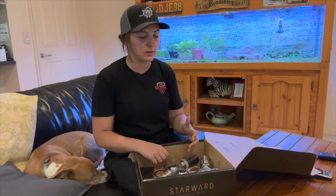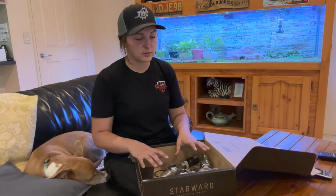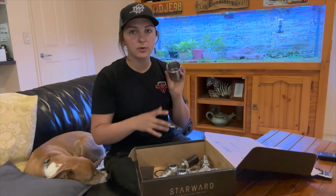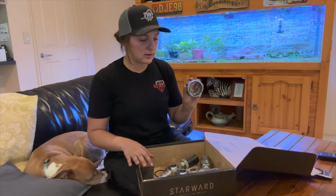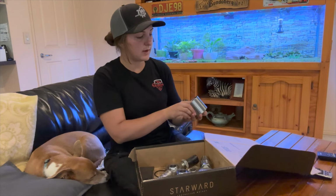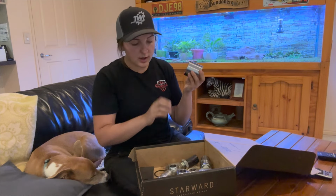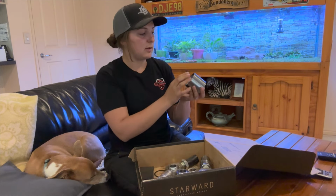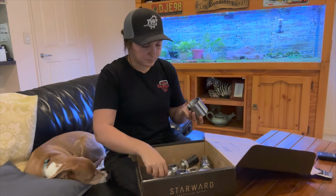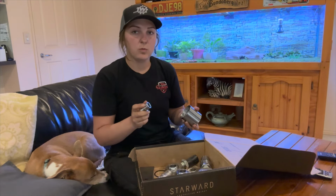Of heims, uniballs, misalignments, etc. So everything I've got here we've purchased from DFI, Design Fab Industries. And I'll start with the 1-inch uniball cup. So on the chassis end of our upper control arm, we will be using these uniball cups. We've got one here that's already got a uniball inside. So the uniball slides into the uniball cup like so. And then you've got your circlip that holds that uniball inside the cup, and a misalignment spacer. We're using the straight steel misalignments and this will act as a wobble stopper.